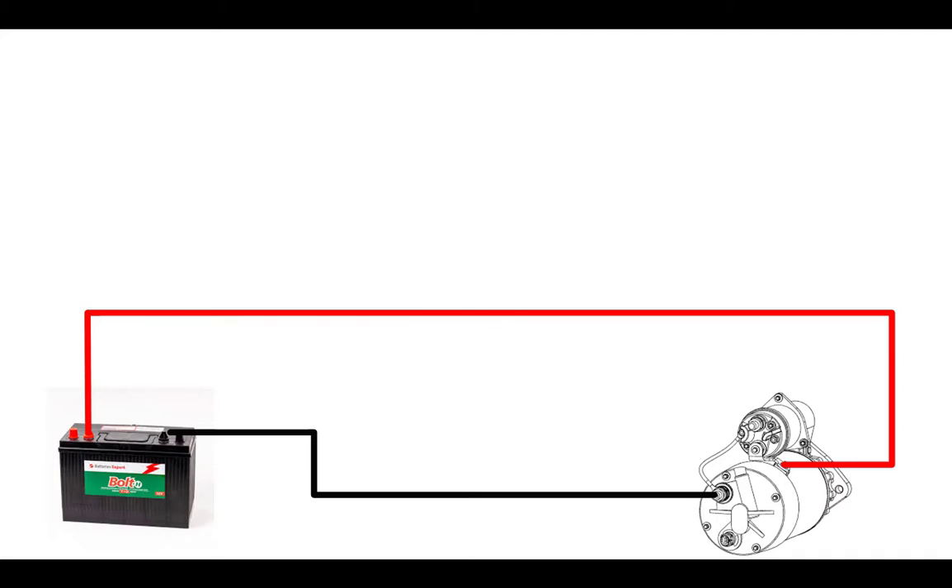With our engine we need to be able to turn the starting motor on and off, so we're going to have to put a switch in. If we measure the amperage on our starting motor when it's cranking the engine, it would be hundreds if not thousands of amps. The size of a switch to run a thousand amps through would be huge, so we're going to have to do something different. In any real system there are no fuses in these wires and no switches — they're just hooked directly from the battery to the starting motor — so we're going to need a really heavy duty switch.